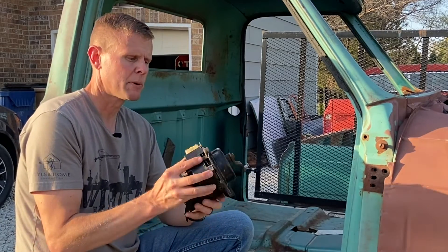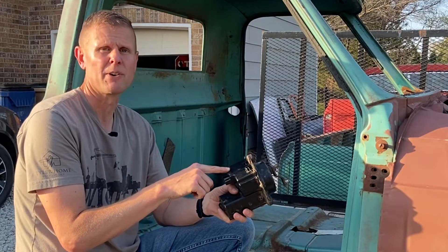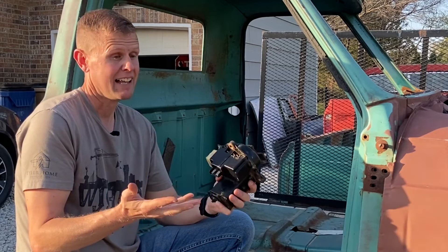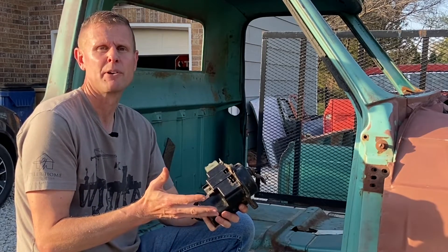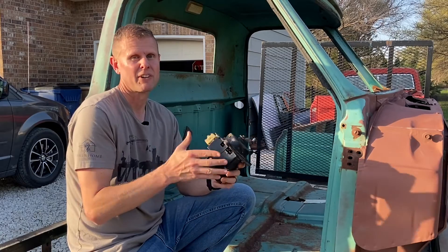Let's talk about some troubleshooting. A lot of the problems with these wiper motors are just that people are sticking the wires in the wrong orientations on the terminals. We also have some bad grounds — either the motor is not grounded or we have a bad ground at the switch on the dash. Last but not least is the switch itself; it's not uncommon for those switches to go bad after all those on and off and wash cycles over 50 plus years, so don't forget to check the switch as well. I sure hope this video has helped some of you guys that have been struggling with these old wiper motors. If any of you know of easier ways to remove and install these things, please type it down in the comments so we can all learn. If you haven't, please hit that like button and subscribe. And if you'd be interested in seeing how to bench test one of these old wiper motors, let me know and I'd be glad to show you. Thanks for watching.